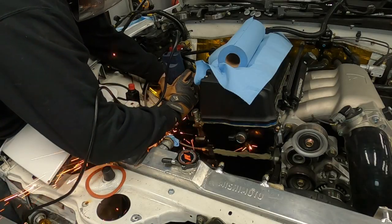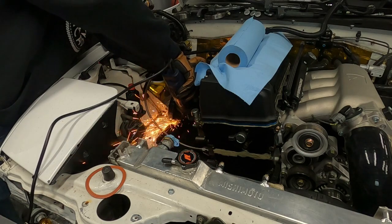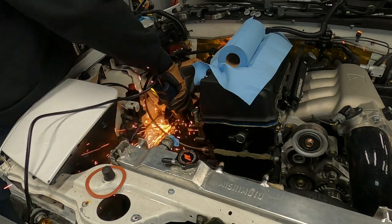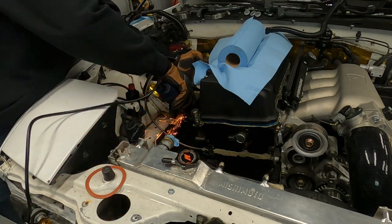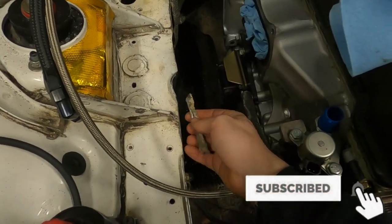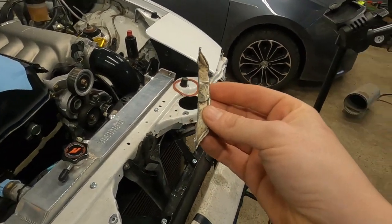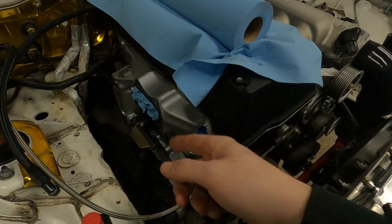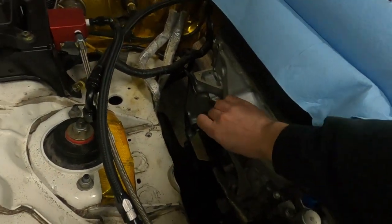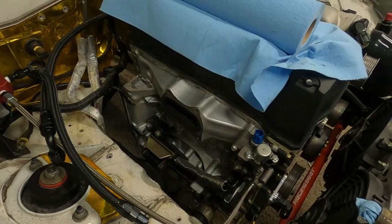We're gonna cut that guy off and make a mess in my garage. Let's put you on a tripod and you can watch. Look at that — so much more room. This is what was there originally. I did clean it up with the angle grinder so there are no sharp edges that I can cut myself on or that could cut the hose. While it's only about a quarter inch thick, it gives me miles of space for the turbo drain. Now that that's done, we can wipe this down and then bolt that turbo manifold up and see what it looks like.